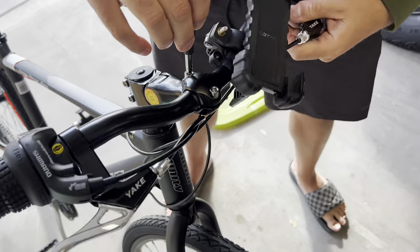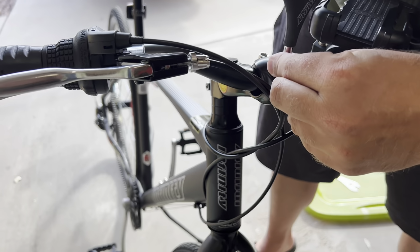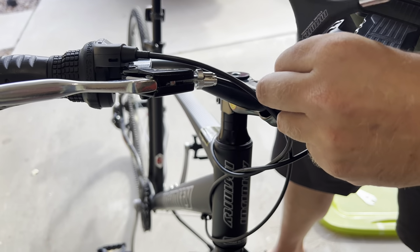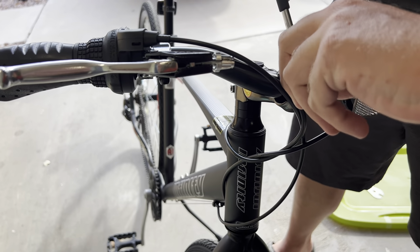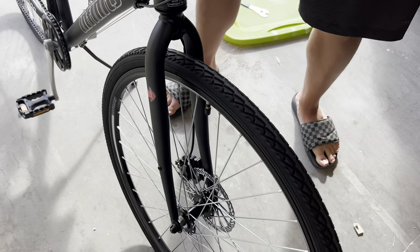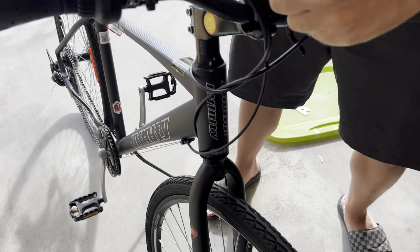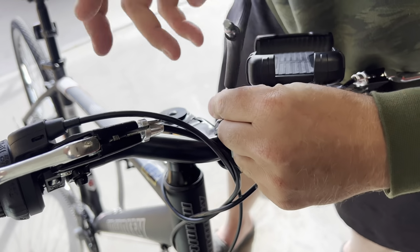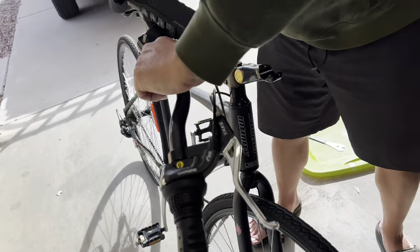Well, Mr. Cameraman's gonna give it a go, and then I'm gonna go try it with Xena. So I put on the handlebars wrong. Yeah. So what's wrong with them? These are all crisscrossed and they're really tense. They gotta be loose. So I struggled when I put this thing together the first time too with that. Because the issue is, if they're tight like this, your brake caliper has essentially pressure on it, like you're putting pressure on the handle. So you have to take this completely off and you have to untwist all this. So, yeah, see, it's all twisted up.